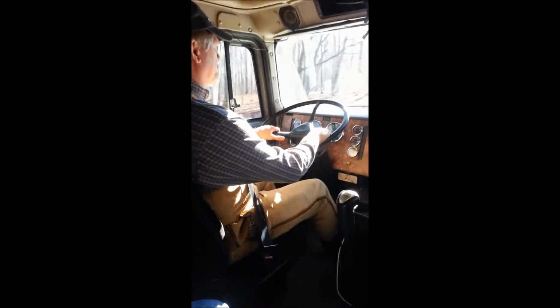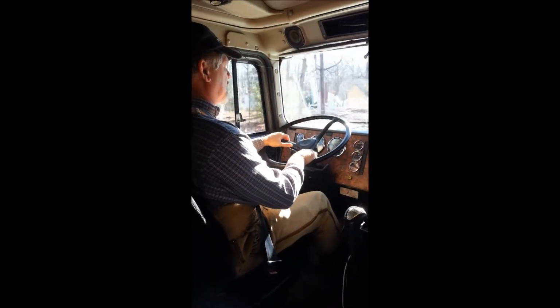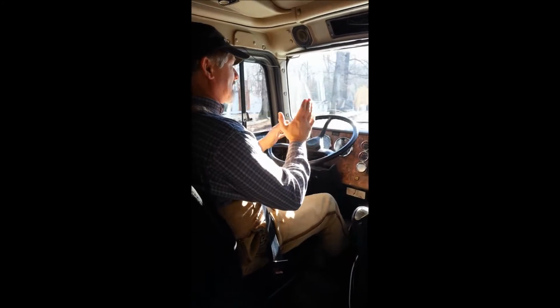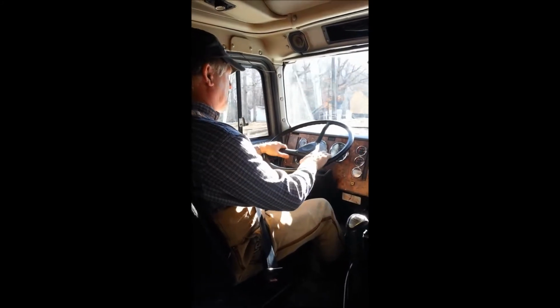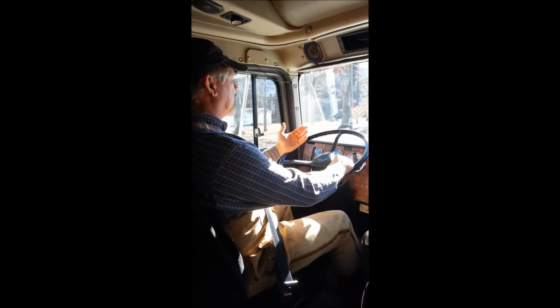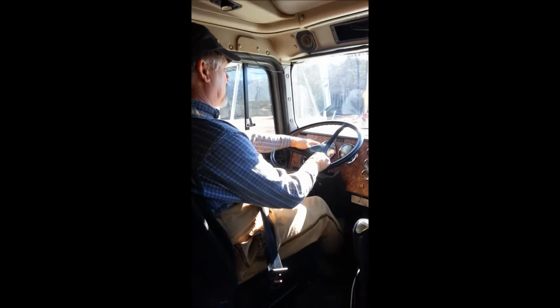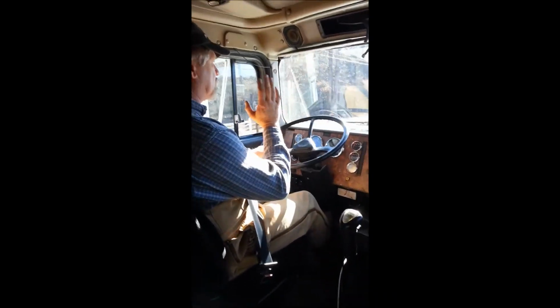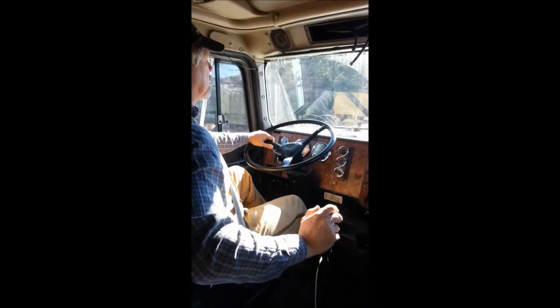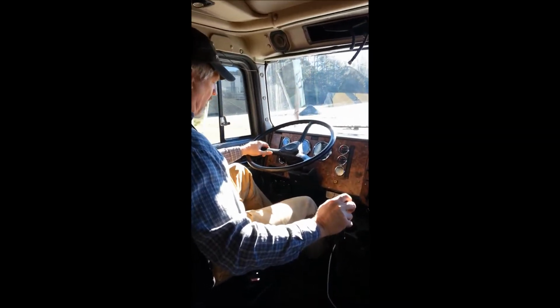All right, now I'm going to get my speed up here just a little bit, and I'm going to make a downshift to 7th gear. All right, I need to set it up. Okay, so we're going to work on that. We're going to teach setup, and as I told you, bring the RPMs down to 1100. So a little bit of brakes, I get down to 1100. That's my trigger to go and make my downshift. Clutch and lever into neutral.